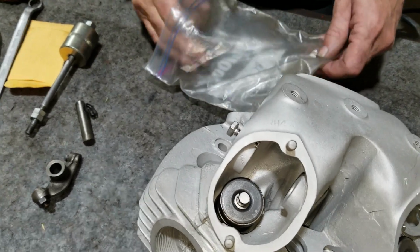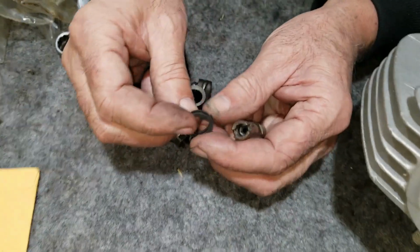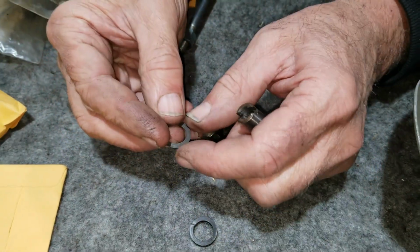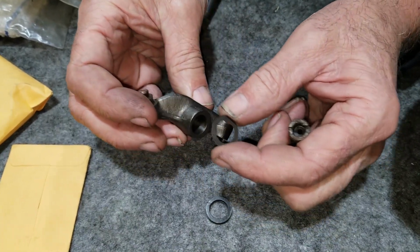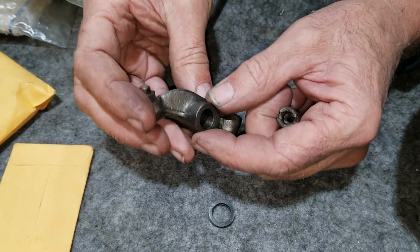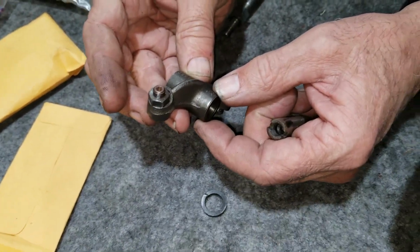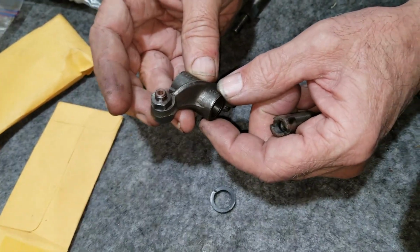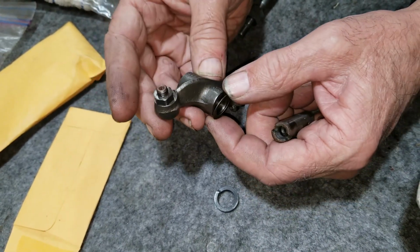There is a Thackeray washer, and most all heads, or at least rocker assemblies, have at least one shim. Sometimes you need more than one shim. Sometimes I've seen motors with two, and in extreme cases I have seen one with three on one valve.